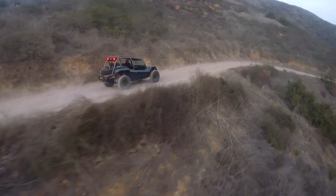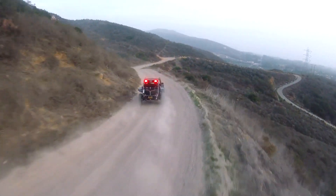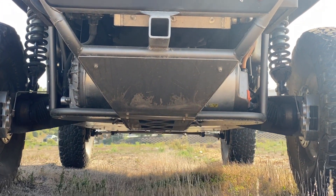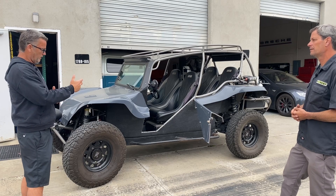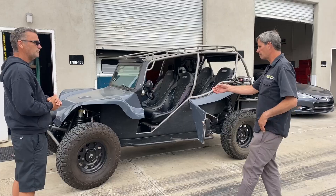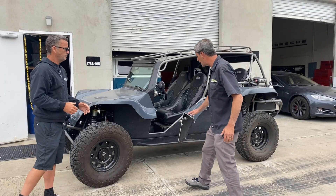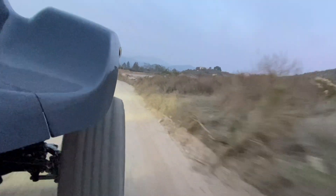We kept the original tunnel, lifted it up, and reinforced the rear end. For the rear trailing arms, this system is called a three-by-three — three inches longer and three inches wider — giving a six-inch wider stance on the car. We run a 33x10.50 tire and we're sitting about 76 inches wide, which keeps the car stable. The beam was widened six inches — three inches each side — and it sits really nice and square with good tire-to-wheelbase proportion, giving a ton of clearance underneath for crawling.